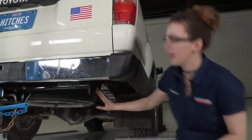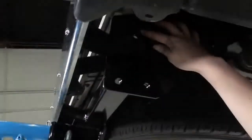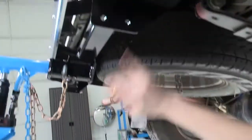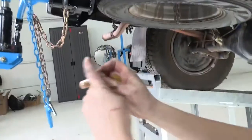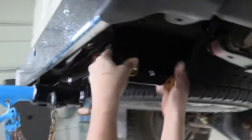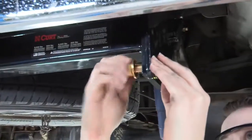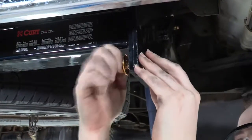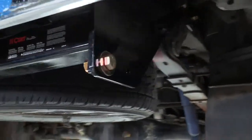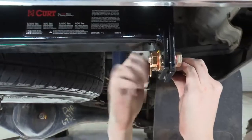So we're going to start on the passenger side here because we already have our mounting holes lined up. You can see we have three — one at the top and two at the bottom. We have our hardware, which is going to be the same for all three holes on this side and on our driver's side. We just have a bolt with a washer and a nut. The bolt's going to go on the outer side here. Slide that through, put your nut on to hold this in position, and we'll do the same for all the other attachment points.